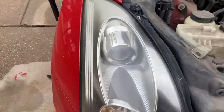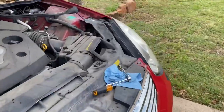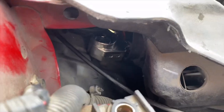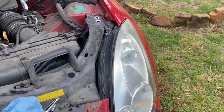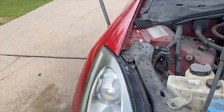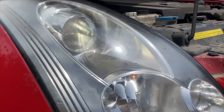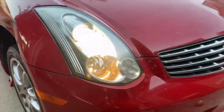And we have nothing, so the investigation needs to go further. To diagnose this further, I went ahead and took all these bolts out - cut my hand in multiple places - to get the headlight off the top, because I didn't feel like taking all that other stuff apart. As you can see, this one is off and I replaced it into this other one, and voilà - we have light. So that means we just need the headlights. I went ahead and did the ballast, but oh well - now we know.